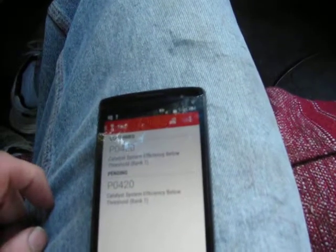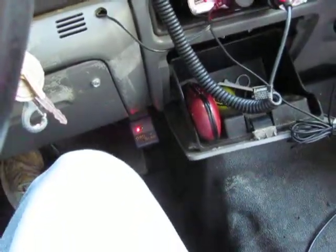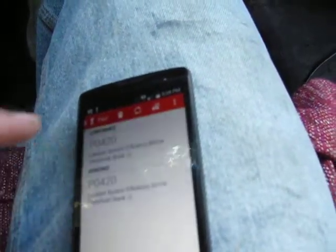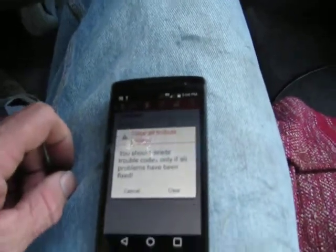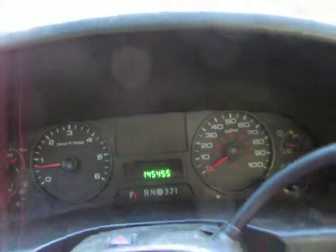So, that's basically the way it works. It gives you your faults. I know there's a way to clear them as well — it says I have two faults. I can hit the trash can, and that should clear the codes. You should delete codes only if all problems have been fixed. I hit the clear button, and it turns off your check engine light. Now, I did not fix this problem, so it's going to come back up. But this is to show you how this system works. Thank you for watching.